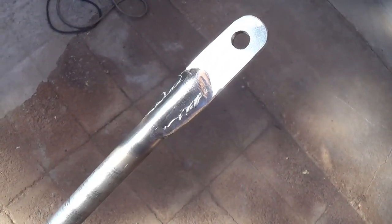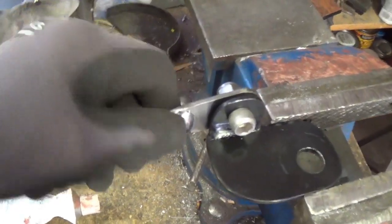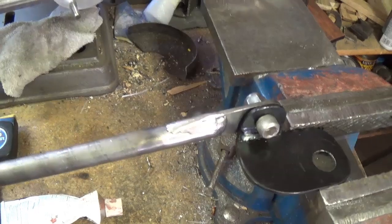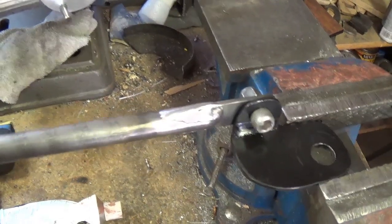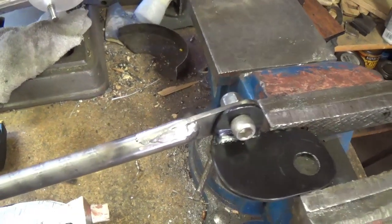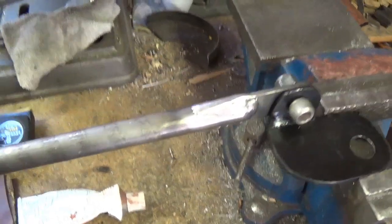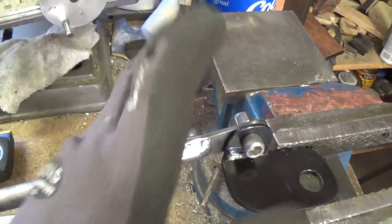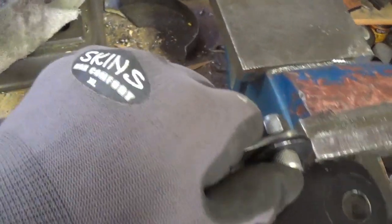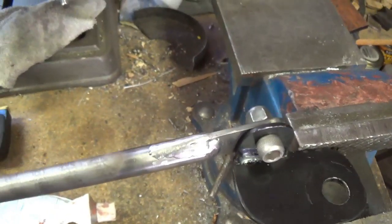Now I have to make that triangular bracket that will come down from the two bolts that hold the spring to the perch. Here's a quick look at how the rod with that piece of strap on the end is going to be able to move up and down, to allow the free movement of the straight axle up and down as it bounces over speed bumps. It's free to let that happen, but it's darn sure not free to let the rod move left and right — that's going to hold that front end absolutely square with the frame. I'm going to use nylock locking nuts to ensure the pressure is snug but not too tight to allow for that pivoting.